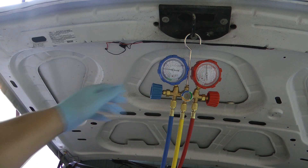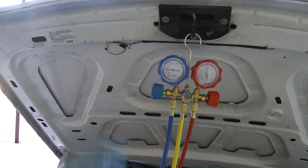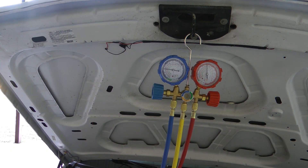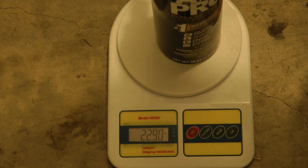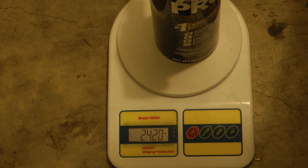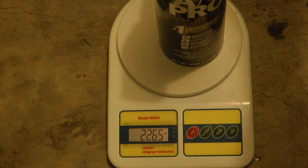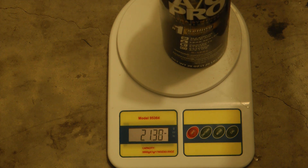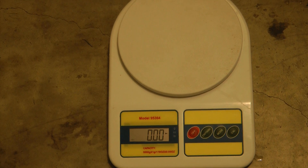I hope it goes without saying, but obviously every time you change the cans, you've got to shut the valves so that you don't spray yourself. So this is how you would do it — take your can, place it on the scale. You can see it's weighing at about 24 ounces right now. Hook that up and it would start pulling the refrigerant in, and you just watch it. When the three ounces are sucked into the car, you cut it — meaning you close the blue valve.